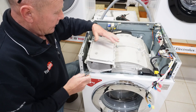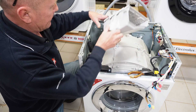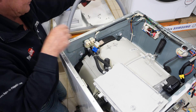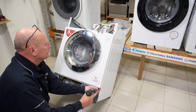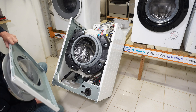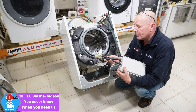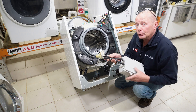We do sell new circuit boards on the website. Next, we're going to get rid of the soapbox — there's a hose here where you need to lift the band up and that will come away. You'll find it quicker to take the water valve off completely with the hoses attached. We can now remove the front panel. IE error code is to do with the machine not filling in the allocated period of time. This can be due to a poor water supply, a blocked filter in the back of the water valve, or one of the coils may have gone open circuit.